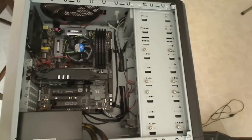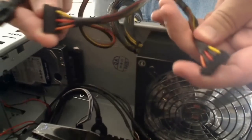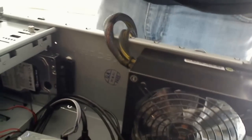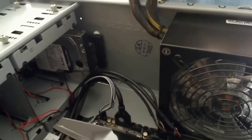Now for the next step of the process, we want to get our two hard drives connected to their power connections. We're going to grab our cable — a modular connection to our power supply that comes with three SATA power connections. We're going to hook this up to both our SSD and our one terabyte hard drive, with the hopes of keeping the cabling very clean and out of the way. Let's go ahead and first plug this into each the hard drive and the SSD.